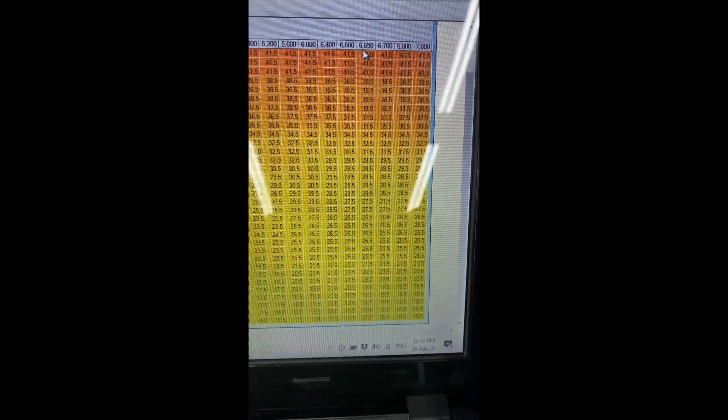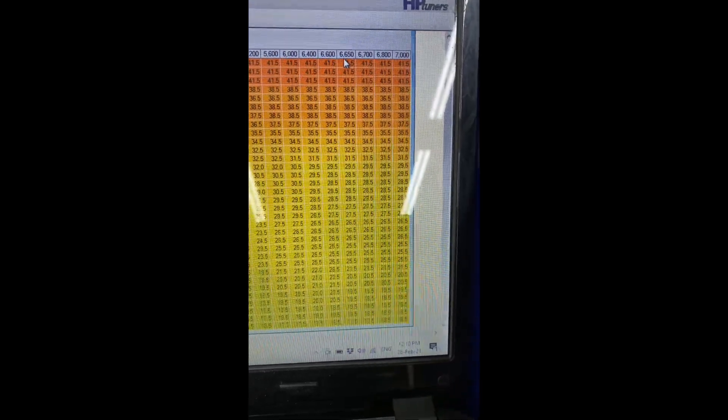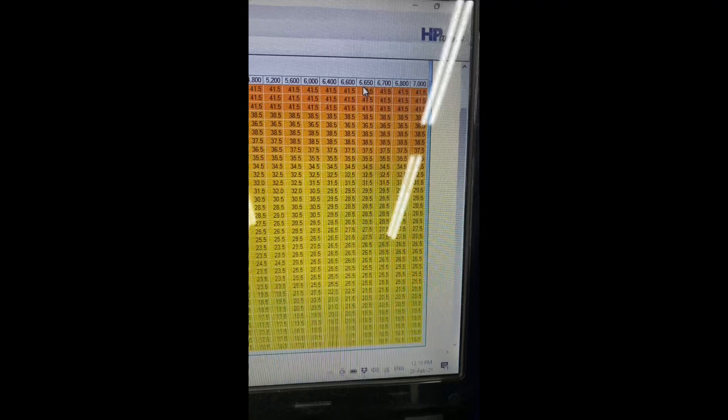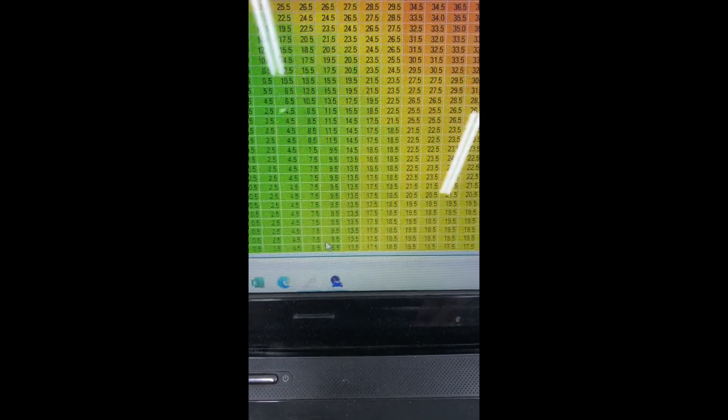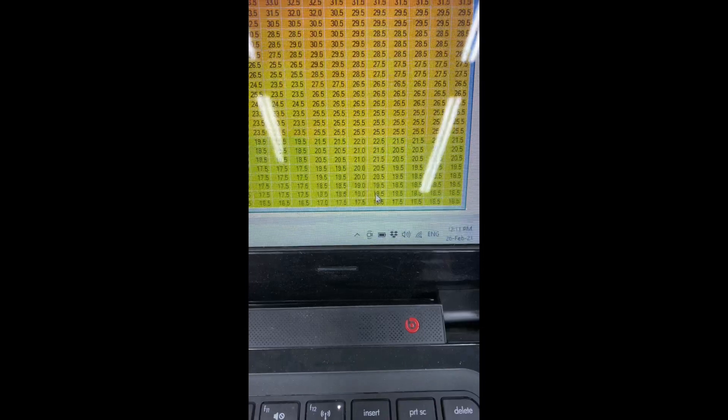We want to control timing very tightly in these RPM ranges. What happens if you don't set that up properly — just with factory settings — it'll interpolate between, say, 4,800 to 5,200 RPM. So whatever numbers you might have in those figures, it will change between them. For instance, if you had 7.5 to 9.5 degrees across a 400 RPM range, it would actually interpolate and sit at 8.5 degrees. When we've got a lot of cylinder pressure, we want fine control to ensure we have the right timing.